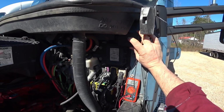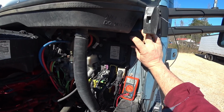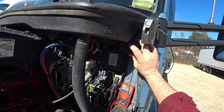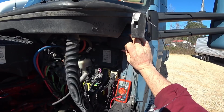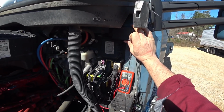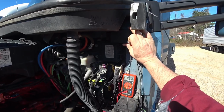That's pretty smart. The inventor of this, that was a pretty smart little add-on, because then I don't have to hunt for a wire that turns on and off with my ignition. I hook it directly to the battery, and when I turn the truck off, the voltage drops below 13.5, it turns off. Start the truck up, voltage goes up over 13.5, turns on. That's awesome. Because Long Haul Larry don't like wiring, this makes it simple.